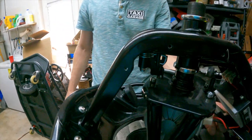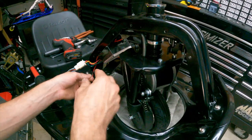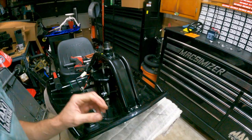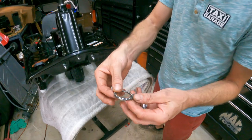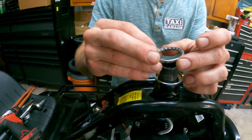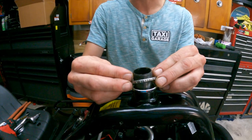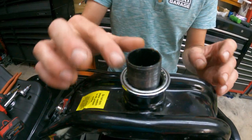Fish the wiring back into the cart but don't plug anything back in yet — there's still something to do with the wiring after finishing the headset installation. Grab your next headset bearing and inspect it. The top headset bearing faces the opposite way: you want the flat spot facing up this time. If the balls are facing up on the upper bearing, that's incorrect — the balls need to face down so it sits with a nice flat lip flush with the other bearing cup.